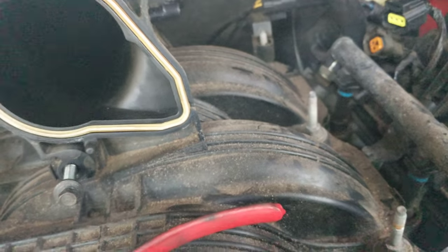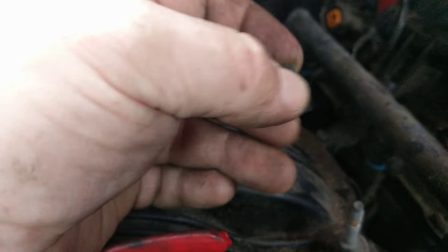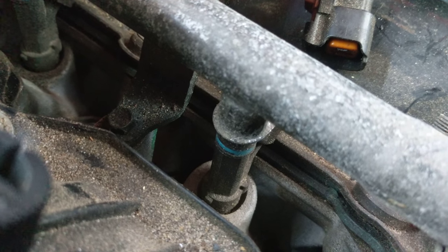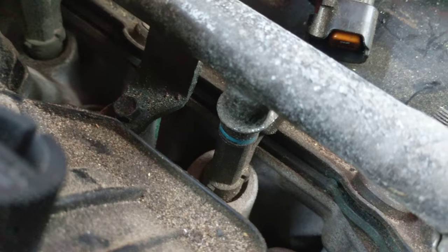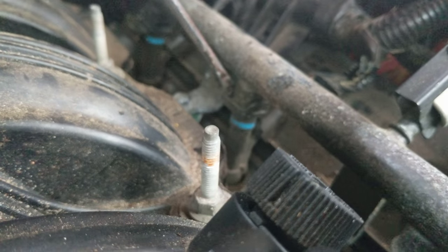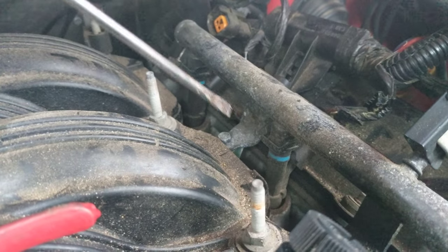When it comes to these fuel injectors being connected to the fuel rail, you have these clips — see that clip? It's got ears, it's got a little slit in the side. You can sort of see where and how it connects. There's one that's actually removed — you see the slits or the keepers in this spring sort of go around the top and keep it retained to the fuel injector itself. So you get in there with a very long screwdriver, pry out this side a bit, pry out that side a bit, and go down with them. Keep your hands around where these go — you don't want to lose this thing in the engine compartment.